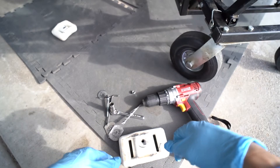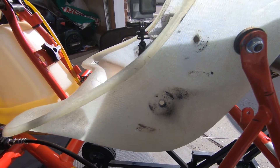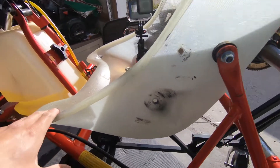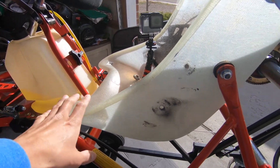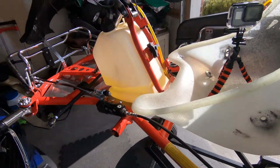Before you get started, obviously you'll need to drill a hole into the seat — as you can see, I already drilled it. Also, before things to consider before you put the weight in is the balance of the go-kart. What I mean by that is you want to put your cart on a scale and see which side of the go-kart has more weight.